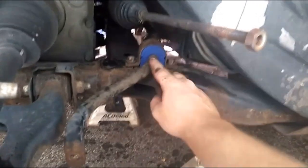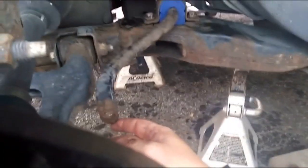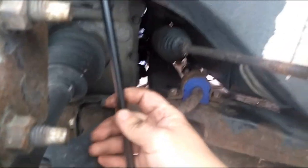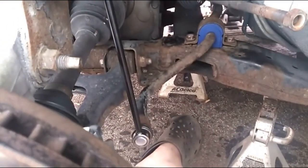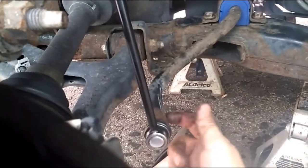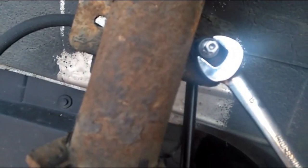The bushing is in there, left a little loose to make it easier to get the sway bar extensions in. Now just do the reverse order and put the new extensions in. I've reattached the sway bar links from the bottom of the sway bar to the top. You can get a small ratchet on the end and use an open-end wrench on the other side, and just tighten it up nice and snug.